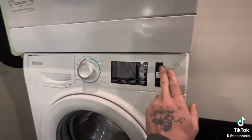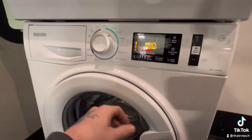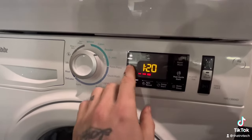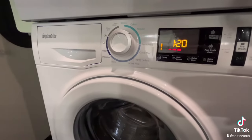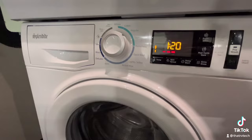You're going to do that by powering it on, going to a regular wash cycle, and here's a very important part: you need to be on a warm cycle. On this unit you have four bars, so two of them would be the most warm setting. That's because you want to make sure antifreeze is coming through both the hot and the cold valve, and using warm water achieves that.